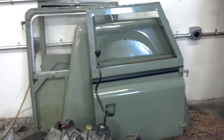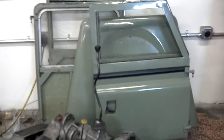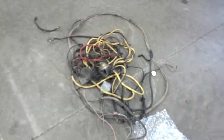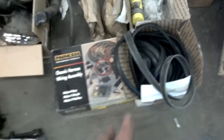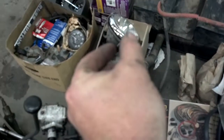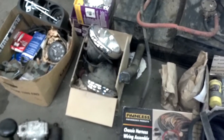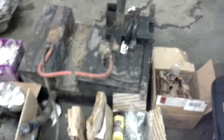Body panels are in great shape, but we've taken all the glass out so that once you start working on stuff you don't make blems on your paint. I highly recommend changing your wiring — we went with a Painless wiring kit. All new seals and rubber. We'll be going with a lower profile thinner radiator so that I have room for the cooling on the rig that's coming in too. And of course we'll just do a little powder coating and sandblasting on the fuel tank.